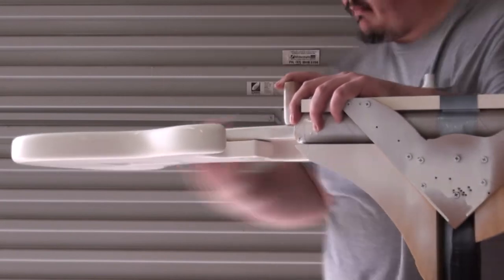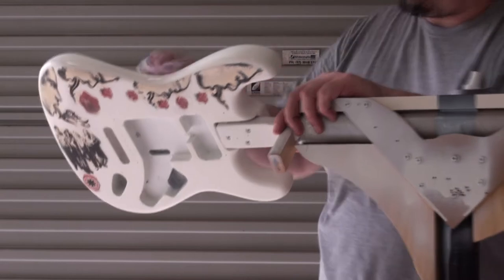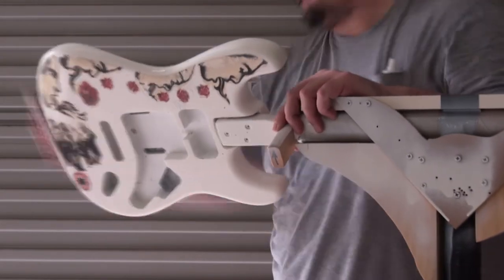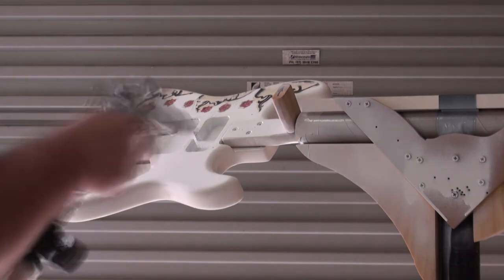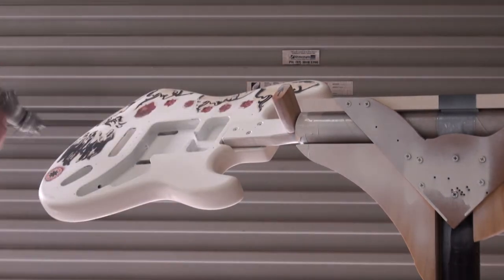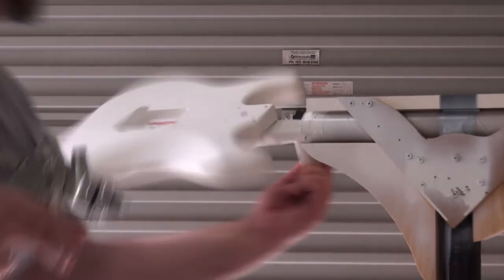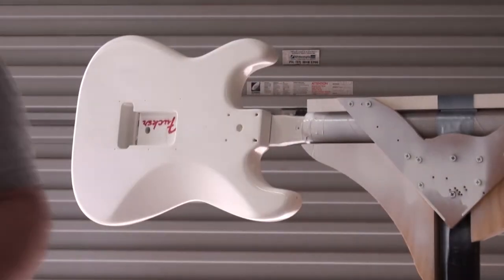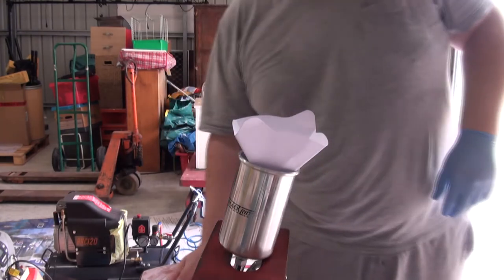I would then use lint-free paper towels to wipe them down. Then I would let it sit for at least 2 minutes to dry off, and then maybe spray it all over with an air blower attachment from my compressor. Or just the paint gun, you know, with the trigger only pulled far enough to let the air through without releasing any paint. Recently I bought a specific wax and grease remover product from the auto shop. I will use that in future.